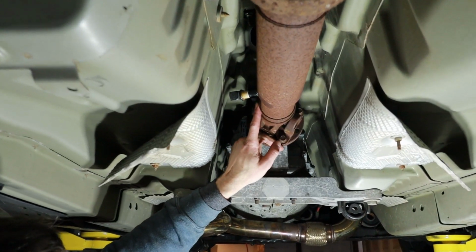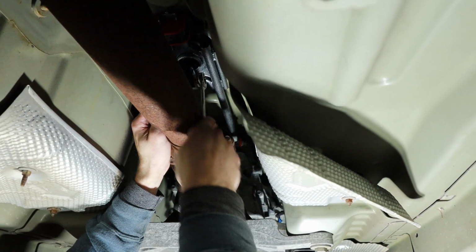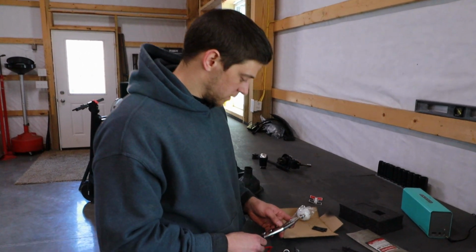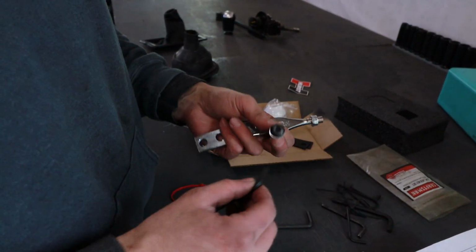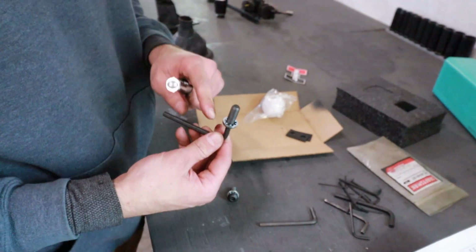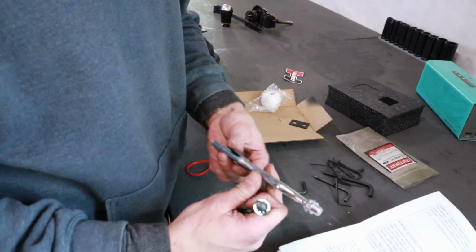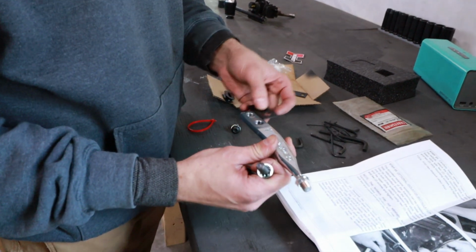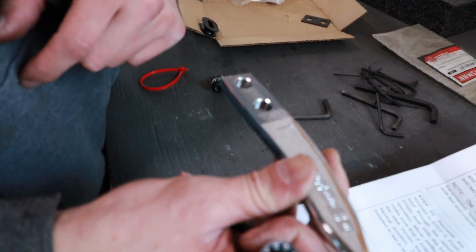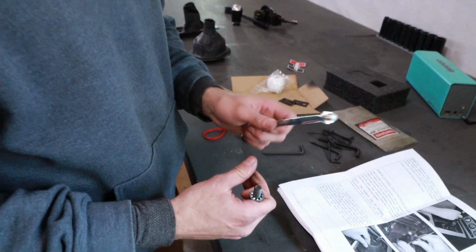Like I said, this plastic bushing is still on the linkage on the car. Now we are going to install the upper stick to the lower portion, and that's going to be with 2 Allen bolts, which are 7/32 hex. And then we've got 2 lock washers on there. You can install these isolators to reduce noise. I'm not going to do that because I'd rather have the grab of these teeth on the teeth on the other stick. So that'll kind of keep it from getting loose and feel sloppy.